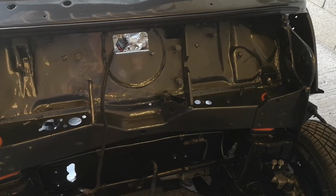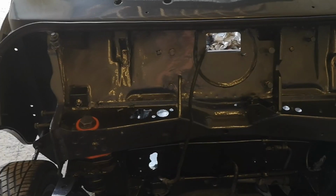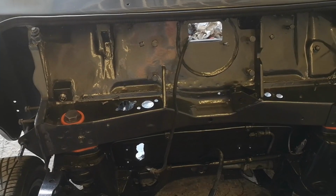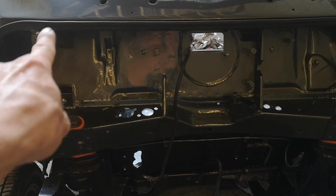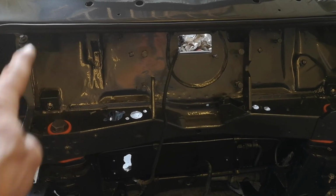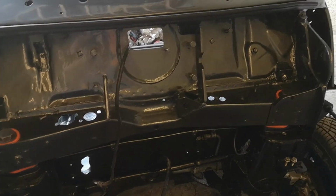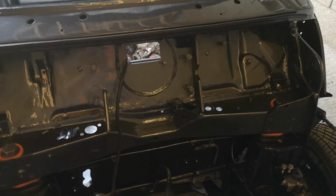in for the wipers, lights. We're hoping that's enough pinnage for amperage. If it's not, if I have issues with power, then I will add a couple of relays just up in here. I have a little space left up there with power right there, and those little signals will fire a relay, which will fire some lights off. Anyway, fires under the bonnet aren't my concern right now.